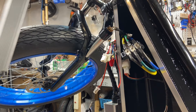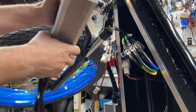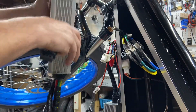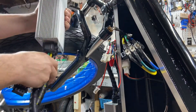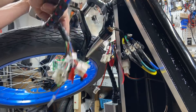Today I'm using a Yankine controller 120/150 — it's 150 amps, 400 phase amps at 100 volts. 150 amps is 15,000 watts and to the wheel, 400 amps is 40,000 watts to the wheel. You're going to get power loss, so that's not a true rating — the true rating is up to 14,000 watts on the meter, which is what we got.